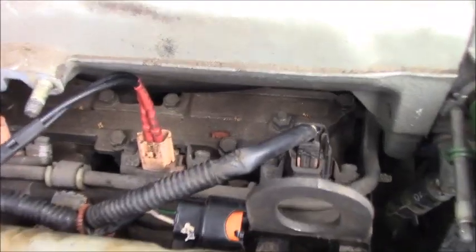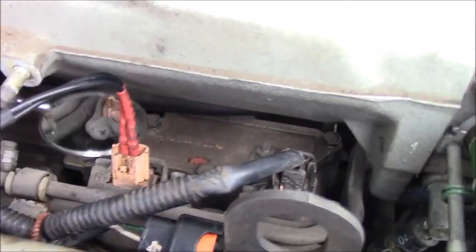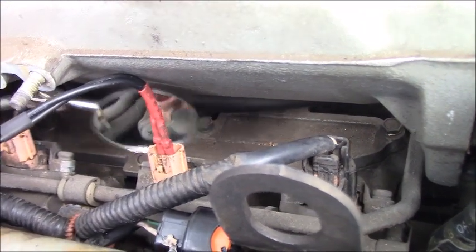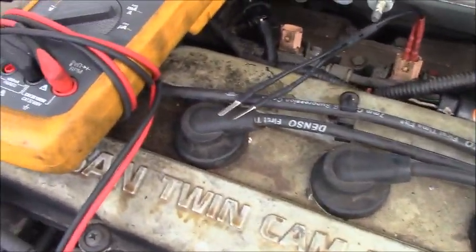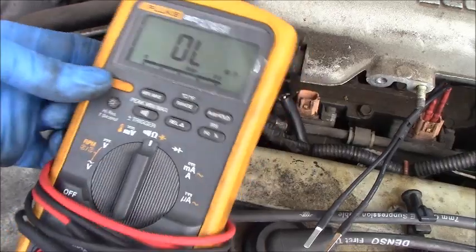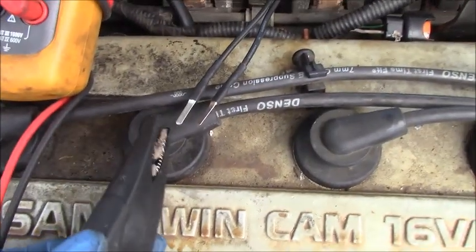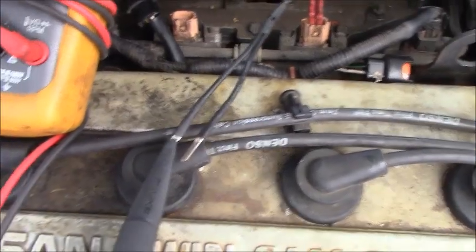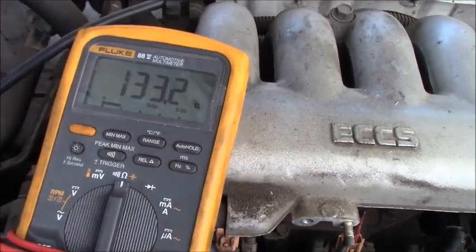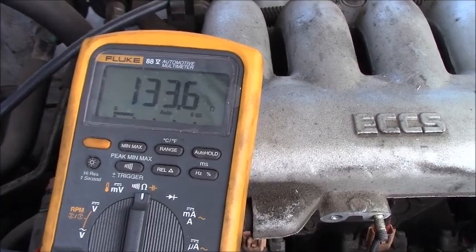You guys see that? Okay, I have the lead connected on fuel injector number 3, and you can see the right connection for me. So, we have the leads out here, as you can see. I use the ohm meter, turn it to ohm. Make sure right now it's automatic. Okay, let's see how many ohm reading here. Okay, oh yeah, right now 133 ohm.